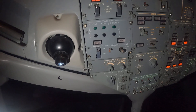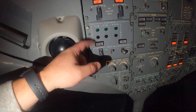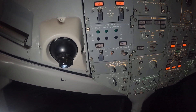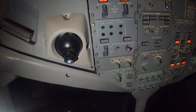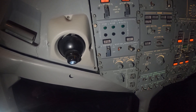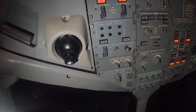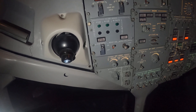This is the boot indicator switch — arguably the most unnecessary switch on the airplane. It controls whether or not these green lights illuminate. Saab designed it because their engineers believed the green lights cycling above the captain's head every three minutes might be distracting, but there's really no reason to ever turn it off. Always leave that switch in the on position. In a nutshell, that's the boots — if you have any questions, feel free to comment and I'll be sure to answer.